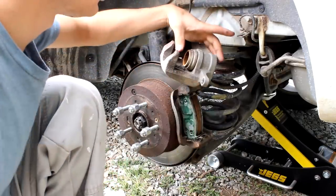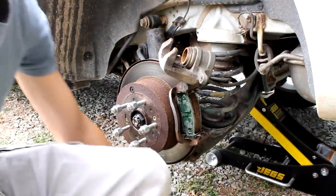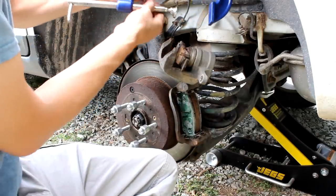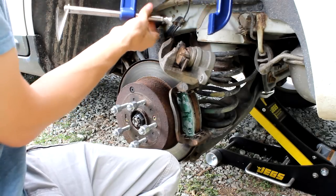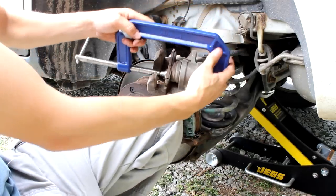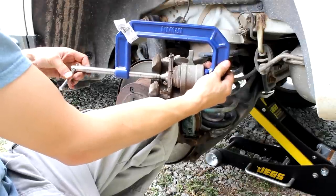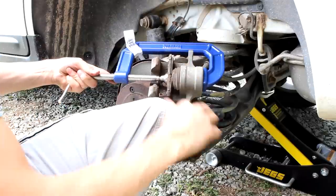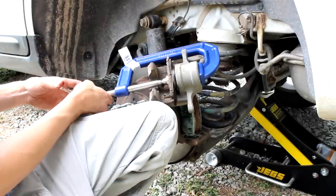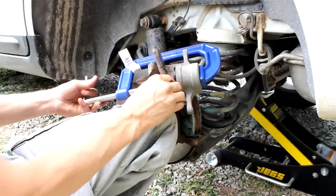You need to compress the piston. If you're very manly, maybe you can do it by hand, but most of us use the old brake pad and a C-clamp. You'll need at least a 4-inch — this one is an 8-inch. The thing is, you're not rushing it; you just want a slow, steady compression. While you're doing this, you can also inspect the boot. It'll be very smooth until you get to the bottom and feel it bottom out. You obviously don't want to go crazy — right there I bottomed out. That's all you need to do.